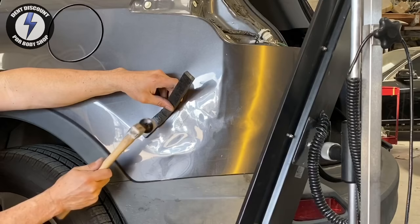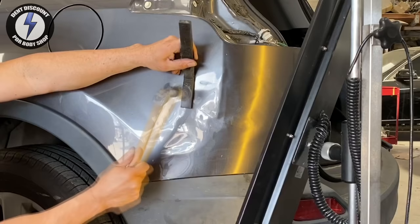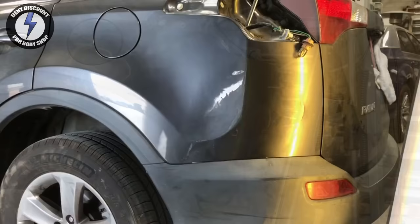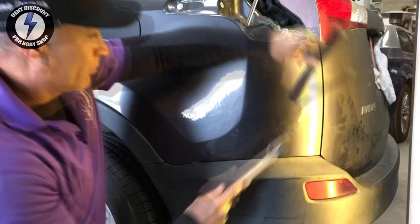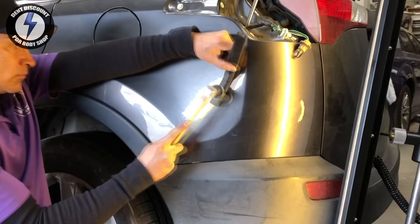I'm going back and forth — back side and front side. I went in with my soft tip 42-inch ultra single bend PDR rod. I had a really good push angle looking down from above on my step stool, applying lots of pressure power-pushing on the body line. The crowns and buckles had lots of energy stored — they would not release completely until I lined up the body line perfectly. The wire harness gave me great dent access on both sides. I had to do a lot of cross-checking with my PDR light.